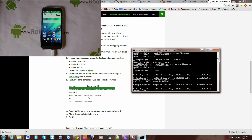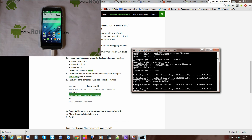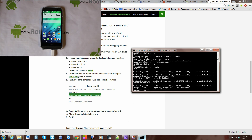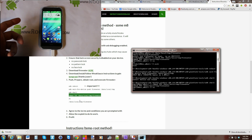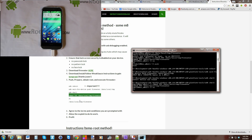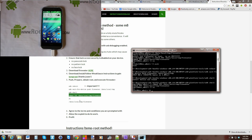Here is where we go ahead and give it the main Firewater command. Copy it — it's very important we wait for root to be activated since we're using that. Hit Enter, then type 'su' to get root access, and we should have a popup on the phone asking for root access over ADB. There it is — root access granted.